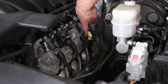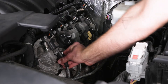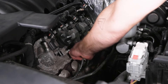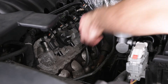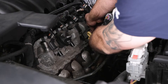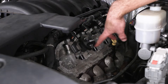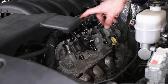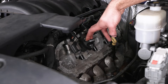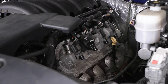Next, we can remove our four spark plug wires. These you can just twist and wiggle off. Next, we can remove the two bolts on each of our coil packs using a 10-millimeter socket. This is the part where it's very important that you have your oil cap back on, because if you drop one of these bolts inside there, it's going to be a bad day.